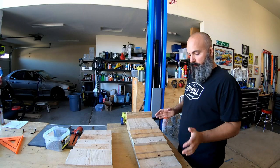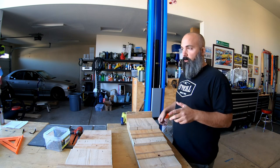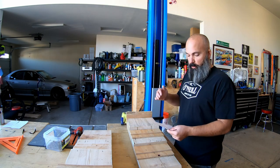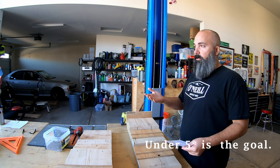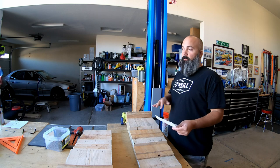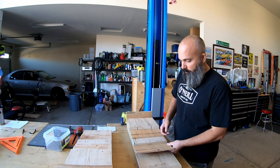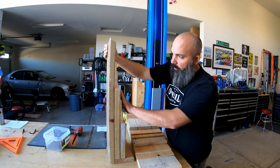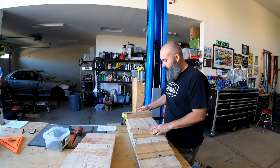Here's what I came up with for the truck side of the equation. By bringing the truck up four and a half inches — three pieces of 2x material — it's going to lower the trailer hinge point three inches down to 11 inches. That's going to lower the pivot angle of the trailer from 7.9 degrees down to 5.95 degrees, so about two degrees. Then by bringing the front of the trailer ramp up the remaining distance, I'll bring it into the three-degree range, which will be ideal for loading in most circumstances. I've got a 36-inch base piece stepping up with some 3/8 plywood stacked, with beveled corners, and I ran it over quickly with a sander to avoid splinters.